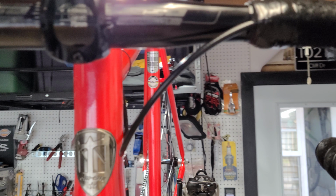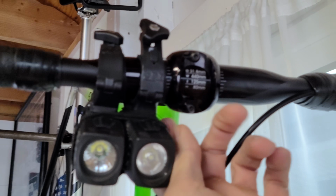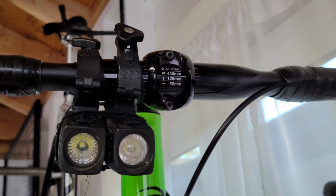So here's the deal with the X2, and I've had this issue. So you go riding, everything's nice. When you install the stem, it fits the handlebars really tight. Like the machining and everything is legit. It's definitely very, very tight. And the machine works right, the engineering's right. The problem is keeping the screws torqued. Because that's when the issue occurs, is when the screws loosen.